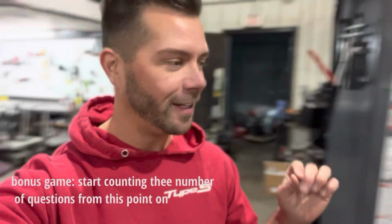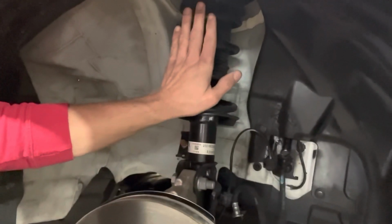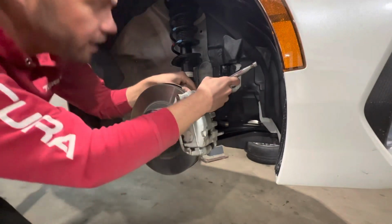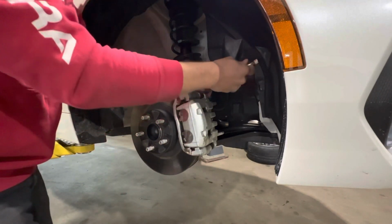As I was getting the car on the lift, I started to get more confident. So I'm gonna try not to look up how to do this or ask questions until I really hit a snag. The main issue, the whole reason I'm doing this, for the wheels and tires that I'm gonna run, I need a 10 mil spacer, which means I need longer studs to clear the shock. So this is a practical mod, not actually a performance mod or anything. The part I'm excited about with this is I can't drop these bolts anywhere except the ground.